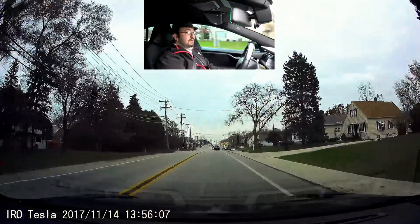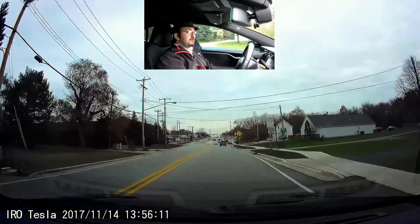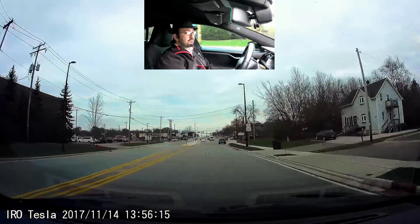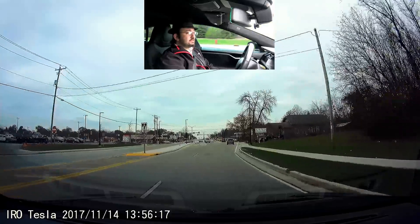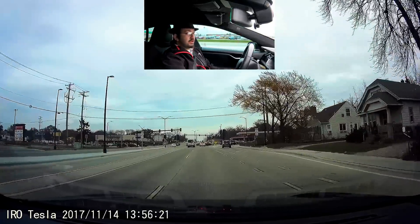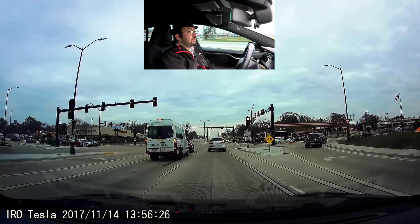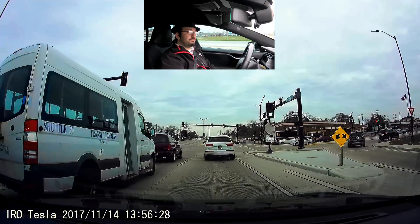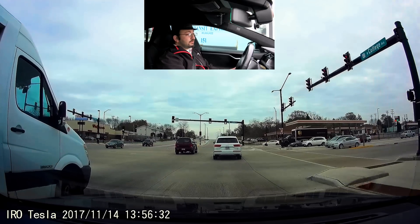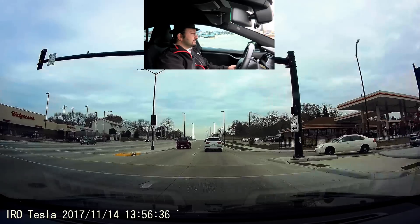Consider it this way: for every two minutes of power drawn from a 15-amp 120-volt outlet, that gives the car enough power to heat the battery pack for one minute. And it's not going to be continuous — once the pack reaches a safe temperature, the pack heater will shut off and it'll continue to charge the battery, then turns on and off as needed, just like when you're heating your house and your furnace will turn on and off to keep the temperature set as required.